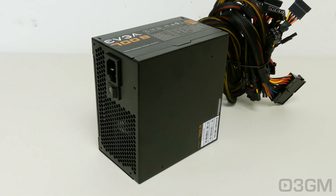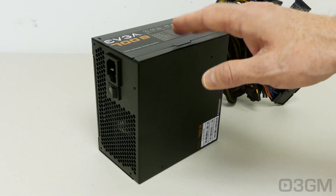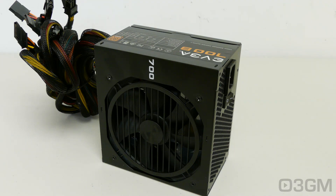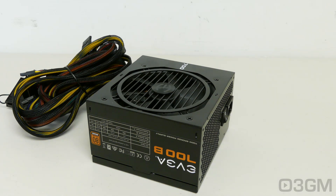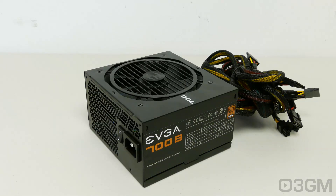Second, it should be at or above 80% efficiency, and this power supply's efficiency is 85% under typical loads. Third, it should meet the latest ATX and other current standards, environmental directives, over-voltage, under-voltage and other protections — this power supply meets all current standards. Fourth, choose a power supply that has APFC. Active power factor correction assists the power supply in being more efficient and therefore stable under load. APFC basically reduces total harmonics, corrects input voltage, and allows for full input voltage range. Thankfully this power supply has APFC.